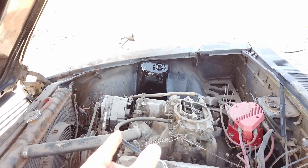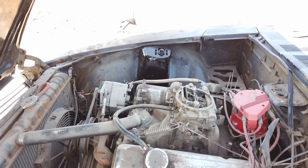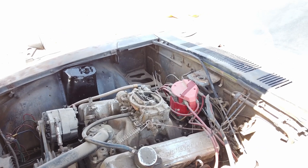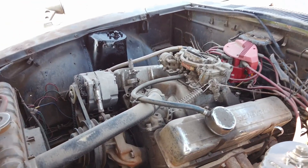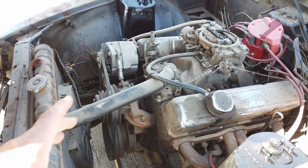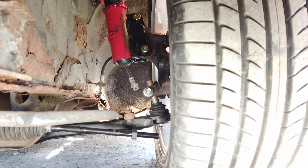I still need to move the engine back and redo the linkages for my four-speed. I'm looking forward to burning less oil with a 3.31 gear ratio — I might even go down to a 3.15. There's acres of rust repair to do. I'll eventually go LS for a fresh motor and to get a Camaro power steering pump to hook up to the Subaru rack. Still waiting on the tie rods.